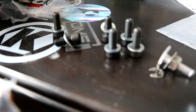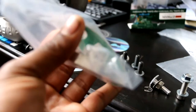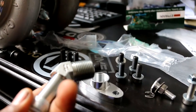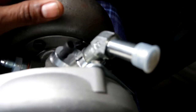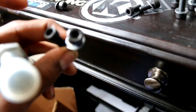Next I'm going to set up some pieces on the turbo. This drain flange came with some hardware — similar hardware but without washers. This other drain piece has to be screwed in here, and I'd suggest some Teflon tape or pipe sealant so you don't have a leak between the threads. You also have to face this fitting in the direction you want it when you tighten it. I actually recommend doing this step after you install the exhaust manifold so you can figure out what position you need it to point in.